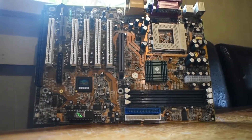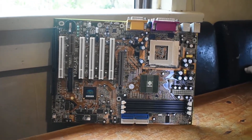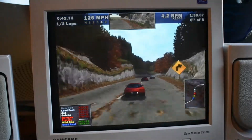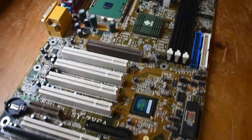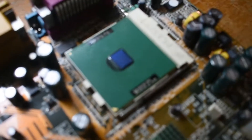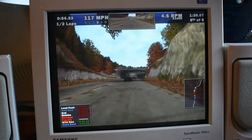Now we get to what I would consider to be a real Socket 370 motherboard — one that supports Coppermine CPUs and has native 133MHz frontside bus support. These boards commonly use VIA chipsets, though you can get higher-end Intel ones. The VIA chipsets are fine — they run great and they're fast, that's all you can want. The best way to ID these boards is to look for VIA logos on them and also see if they're Socket 370 and include common features like AGP. These things are super good — they just work. Native 133MHz frontside bus support is important if you want to run higher-end Pentium 3s, and these VIA boards can handle up to around a 1GHz Pentium 3, which is more than fast enough.